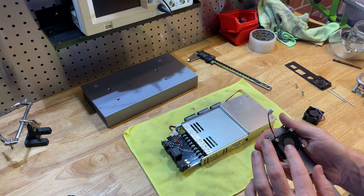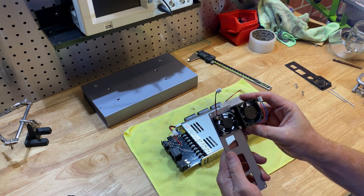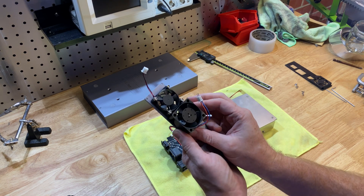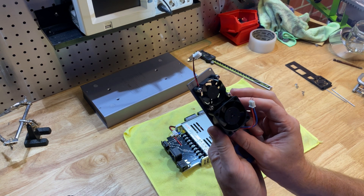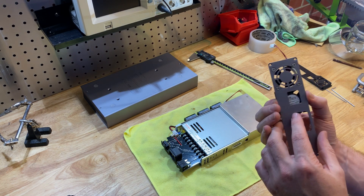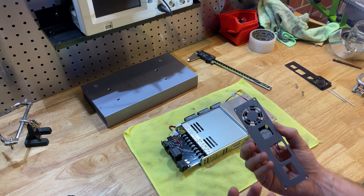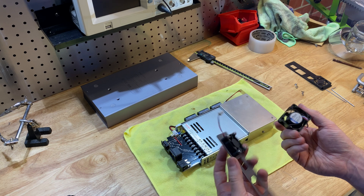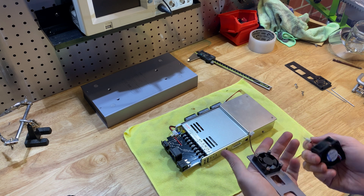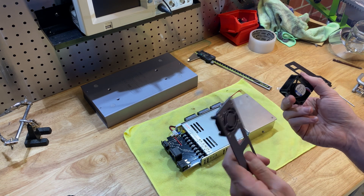So that's the guts of the power supply in case you're wondering. Here's the stock fan, here's the new fan — you can see the size difference. But at the same time, this new fan would fit if they wanted it to, so I'm not sure why they didn't just do that. A bigger fan means you have to spin it less, less RPMs, less noise, just better all round. Anyway, let's take these fans over to my power supply and I'll show you a noise comparison between them.